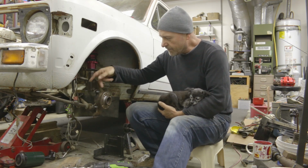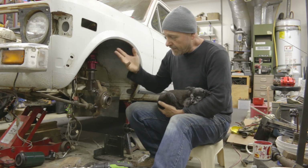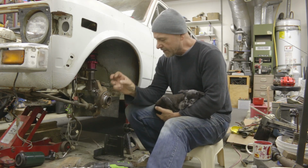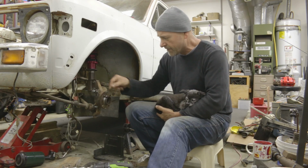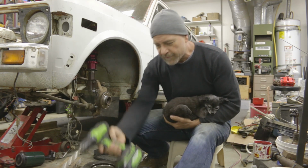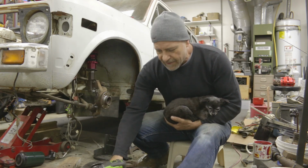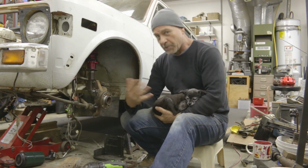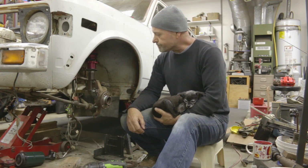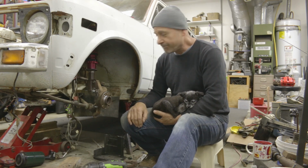So, when I last left off, we were talking about drilling through these little bosses for the brake, and the steel isn't super hard. It drilled pretty easily, but it was a little bit grabby. Even though I was only going up like a 64th of an inch each cut, it was a little grabby. So you really need to develop a nice feel for drilling through stuff, or doing anything mechanical. The feel is so much a part of it, and that's just something you acquire as you do this kind of stuff. Right. So I just totally had a brain fart. Anyway.